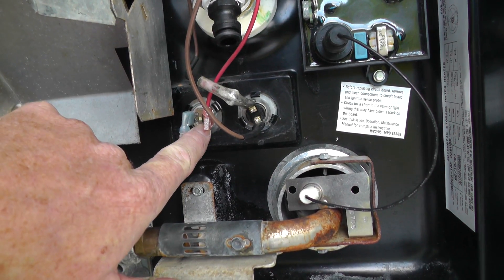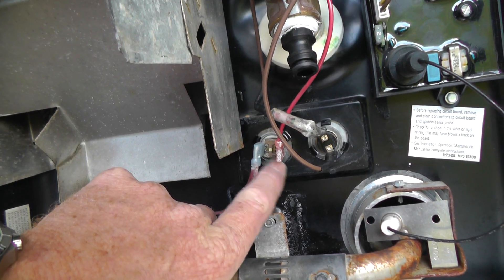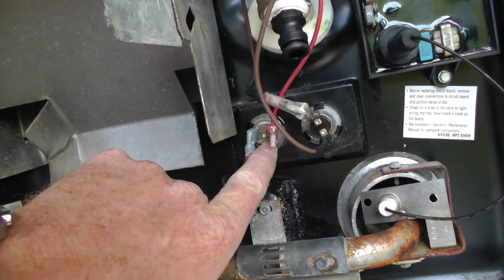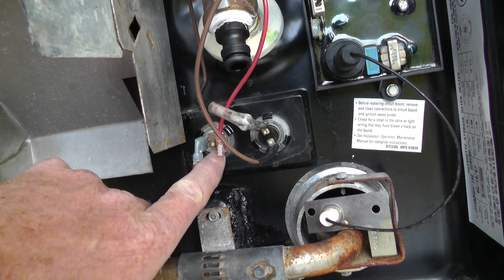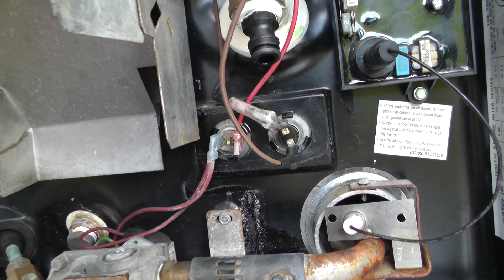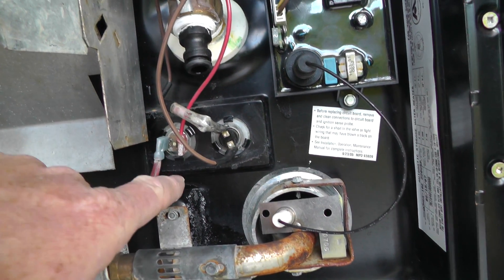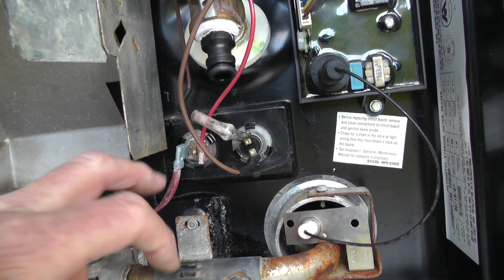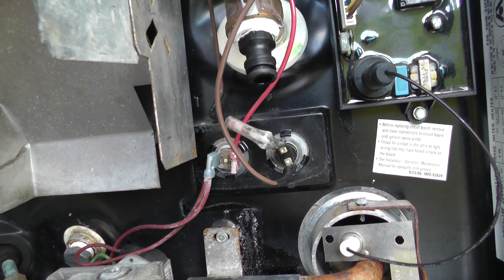You also have another temperature-sensitive switch, and this one is different from the primary one in that the primary is set to about 60 degrees Celsius, whereas this one is set at around 80 degrees Celsius. This one is what they call the ECO — electronic cutout. What it does is if the temperature for whatever reason gets above what it should, this switch will go from a normally closed circuit mode — when below 80 degrees Celsius — to an open circuit mode, and in doing so that is what causes the red light to come on.